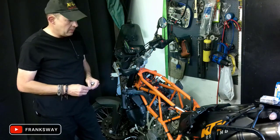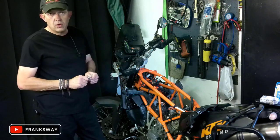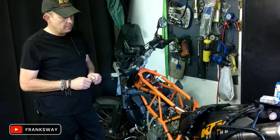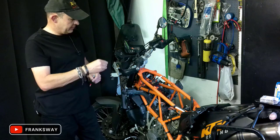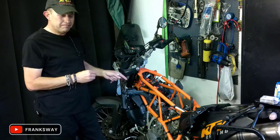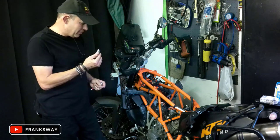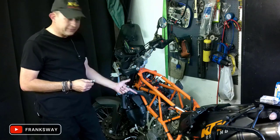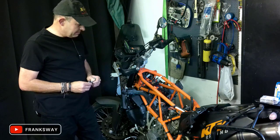It's 0.35 bar. The Golf unit, the Mark 1 Volkswagen Golf, is 0.30, and I think even the old air-cooled Volkswagen Beetle is about 0.30 bar. The length is the issue for me, and if you screw it in, there's not a lot of meat inside that you can screw it into. So comparing the 300 rand part, or 380, whatever it costs these days, versus a 50 grand rebuild on a motor, it's easy maths. Just buy the part.